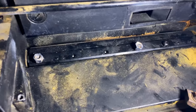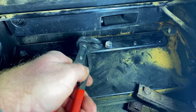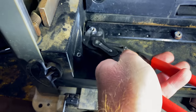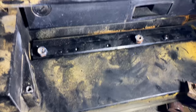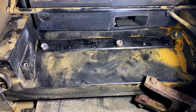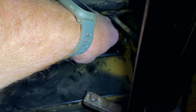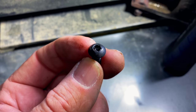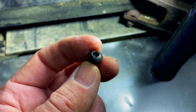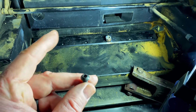So I had to go back to the old school way. You can see I welded nuts on them and you can see they came right out. Obviously we're going to let them cool before we take them out. But sometimes when they're stripped, having an extractor will work great — like the RBRT — but you're not going to win every time. On the ones that weren't bad, they work great.